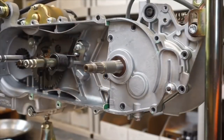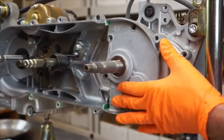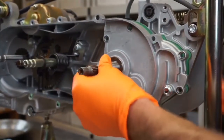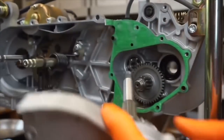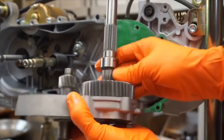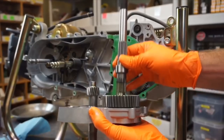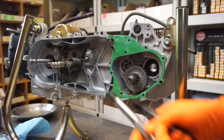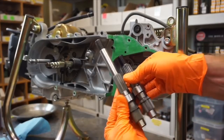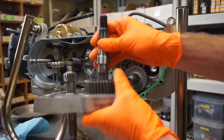Now that they're all loose, on the other side you've got your axle. I just normally take a rubber mallet and lightly tap the axle just like this. There's our axle right there. I'm going to pull this guy out just like this. Notice these axles — they look exactly the same, one's just longer than the other. So just pulling this guy up, sliding the new axle through.